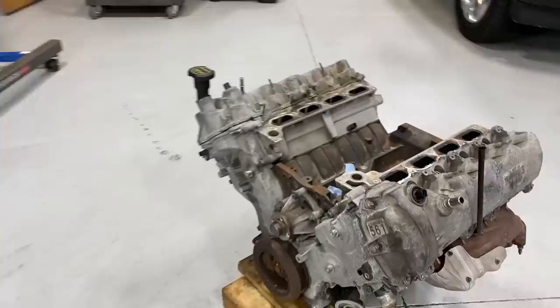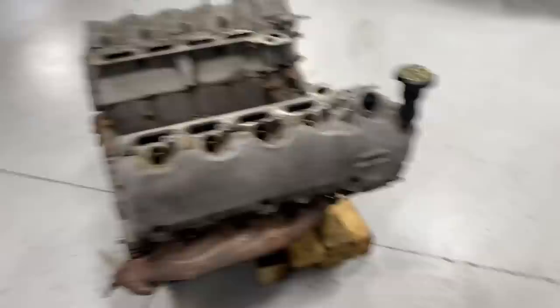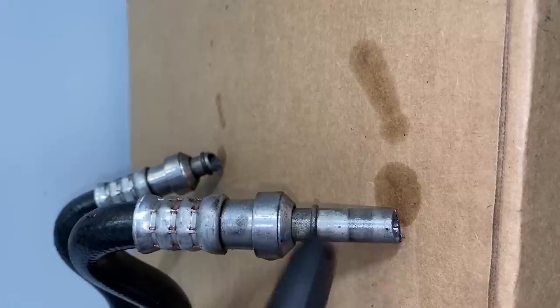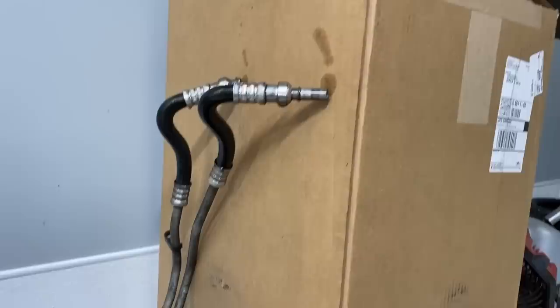This is the engine from the '07 right here. We just got it out last night, swapping everything over - all new manifolds, pipes, everything - that's all good to go for the customer. And whenever you're in there changing all that stuff, you want to change all your heater hoses and coolant hoses. Of course we're changing the trans cooler lines because they like to crack right here at the quick connect up by the radiator. Up in the front of the vehicle where they connect into the coolers, the quick connect where it goes into the actual pipe - they like to just shear off and crack right there, dump tons of fluid, and burn your transmission up in about five minutes or less.